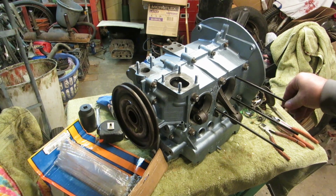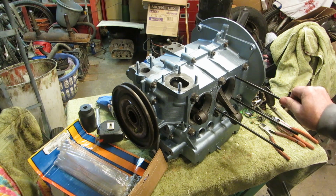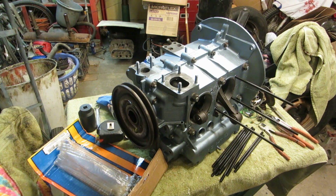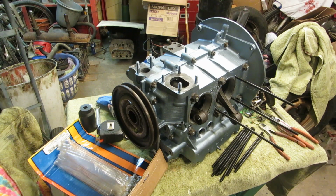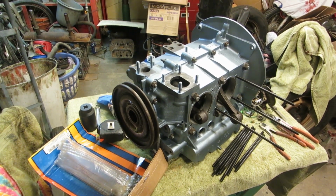And then I've got a battery light going on. Then I'll charge that battery, and I'll be able to take a trip to the store and buy some cleaner. And also I'm going to buy a gallon of lacquer thinner so I can wash down my tin. I bathed it all in that 40-to-1 mix, so it has oil on it, and if you spray any color on it, it could bubble and peel. So we're going to wipe that down with some lacquer thinner before we spray those. Alright, I'm going to charge this battery, and I'll be right back with you because I'll have that distributor finished, and we'll put it in the engine.